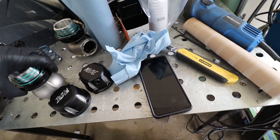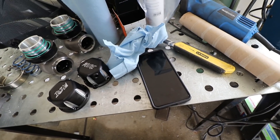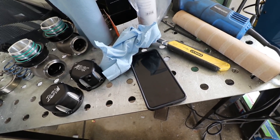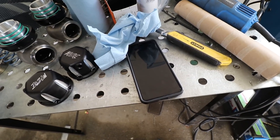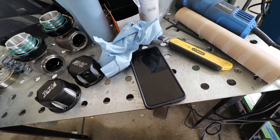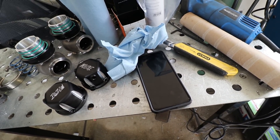The other thing is, how do I turn it down on the launch then? You're going to run 12 pounds, drop the RPM a little bit. Take timing out of it. Yeah exactly. I mean the nice thing is I'm sure we can figure out a way to do it — a timer with some ignition retards built into it and stuff. Anyways, I don't want to take your time. Have a good one. We'll talk soon.